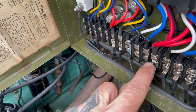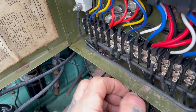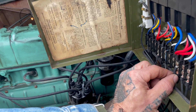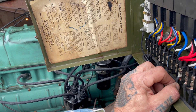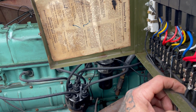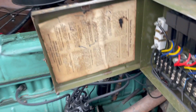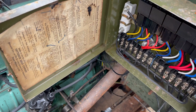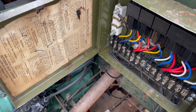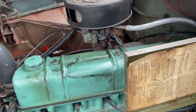This one right here on top — I just replaced a horn relay like last month. So I loosen this screw and I'm going to take it off. Look at that — so that horn relay is draining. It's not always this easy, but this one was pretty easy. So I've got to figure out a new horn relay situation, but yeah, that test light just paid for itself.